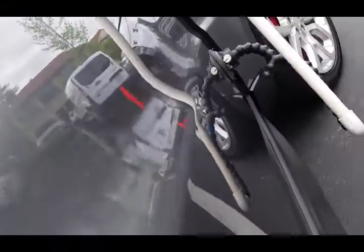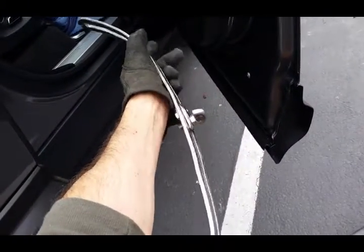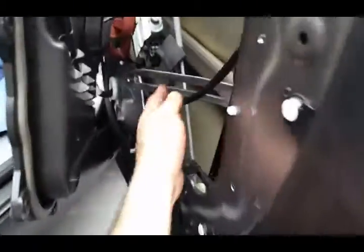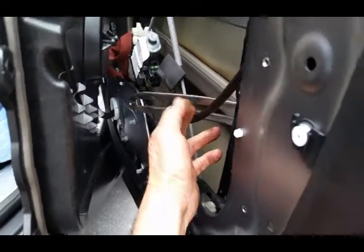There it is — nice and tight. I push out here and I've got good power. That's how I use my DentDial. I basically use it as leverage: if I'm pushing over here and I'm based over there, I'm pushing with plenty of power with just my left hand. It's basically like a crowbar — you insert it, slide your fulcrum where you need to be, push, and you've got all the power you need.